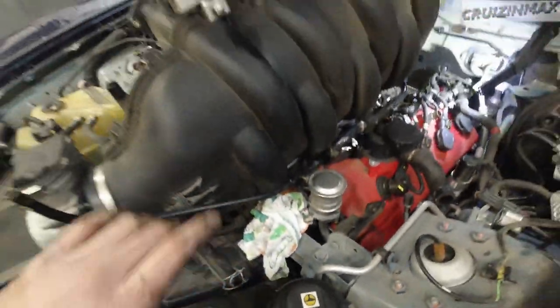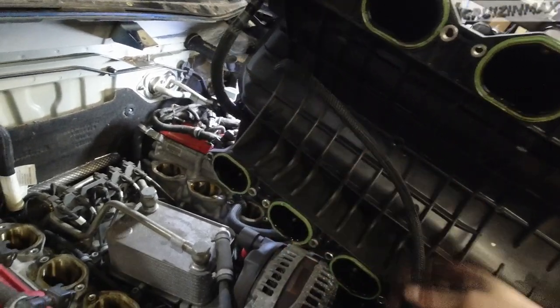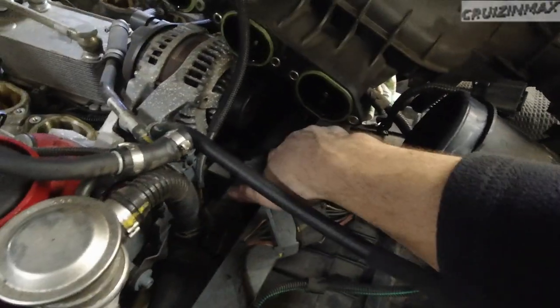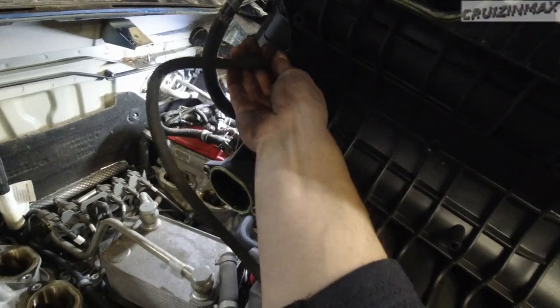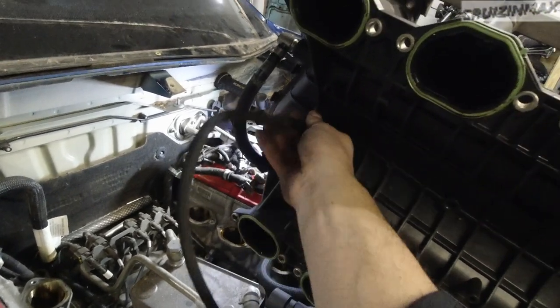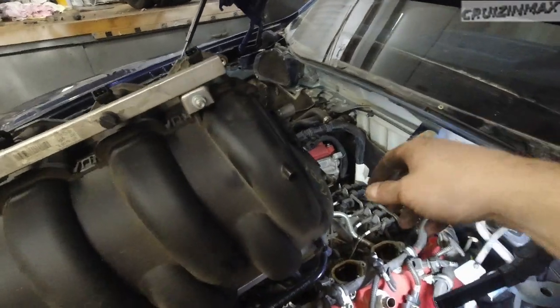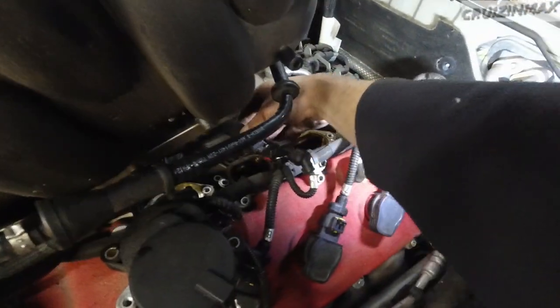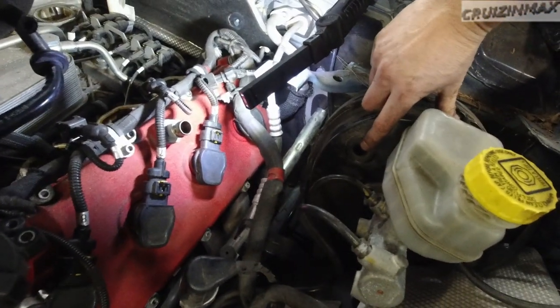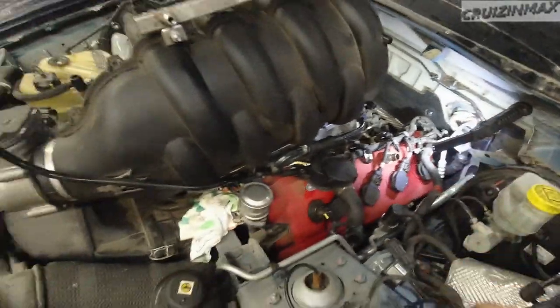Mission accomplished, though we got fuel coming out. The reason the intake is like this is this harness is attached underneath the intake right here. I need to remove this line here — yes, it does twist. That was fairly easy — just a vacuum line, put it aside. This line attached to the back of the intake is another vacuum line. Follow it to the end and remove it from the brake booster right here — pry it out with a screwdriver, lightly, careful not to break it because it's plastic. Then you can remove it with the line.